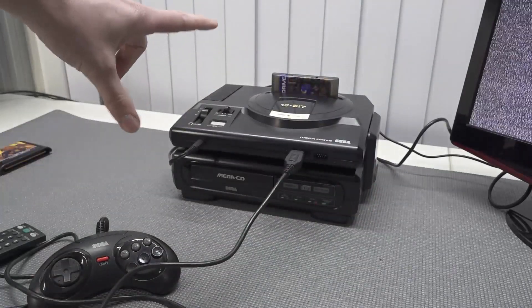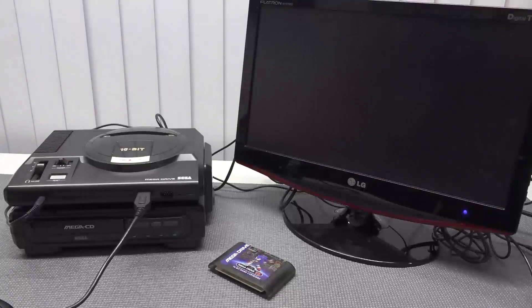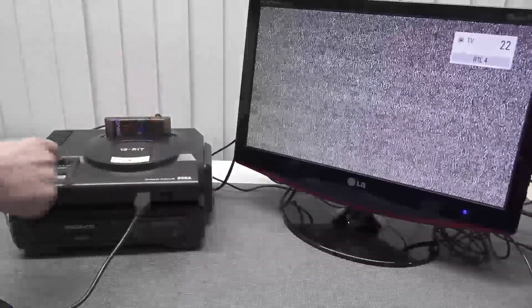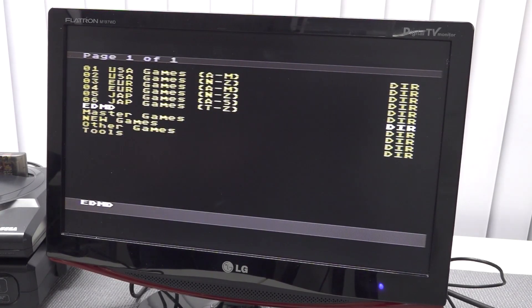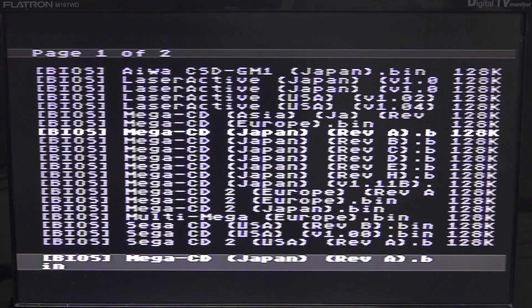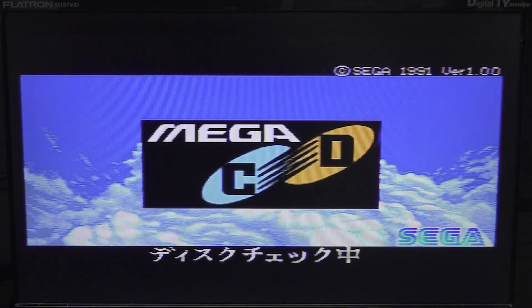With an EverDrive built in, we can do some more awesome stuff. If you want to use an EverDrive with a Mega CD, we can do some great things. When you turn on the system itself the Mega CD will boot up. This feature doesn't work when you're implementing the EverDrive normally, but when you plug this thing in it will boot up into the EverDrive. A really cool feature is that if you load up a different BIOS into the EverDrive, you can basically unlock your Mega CD for a Japanese or US region. You can load up different BIOSes from the menu — if you want to play different regions you don't need to do any modifications whatsoever. So let's say you want to play Japanese games — boot it up, load and start — it will load up the BIOS and show it like an original system.